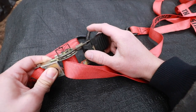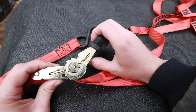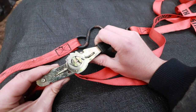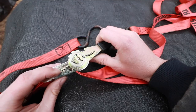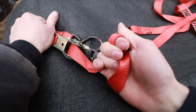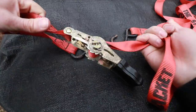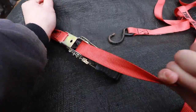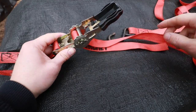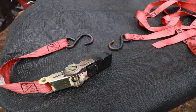So again, I'm lifting up on this release handle, this release tab — look at what that cam does, see how it pushes back that locking tab. You may have to pull a little bit tight, but with some force we can unspool the webbing in the main spool and pull it out.